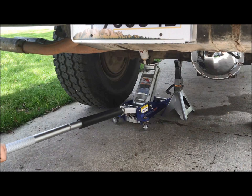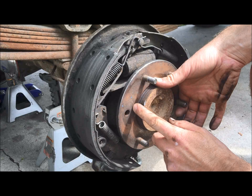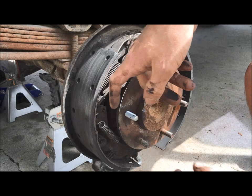With both rear tires of the truck off the ground, you should be able to grab this hub and rotate it enough to find a spot in your drum brakes to seat the new stud. So we have that position — take my new stud and thread it on through, and I'll get this set up to pull that stud into place.